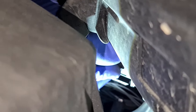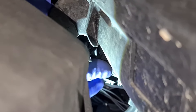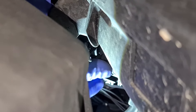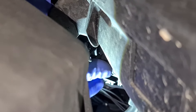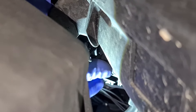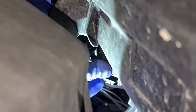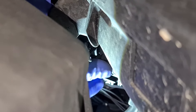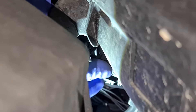Once you take it out, just remember how you put it back in. The H7 bulb pin locator should be facing up — the opposite direction of the clip, as you can see here. On the inside you can see where the sliders are and where you need to slide them through, so you've got a gap here and a gap on the other side. Now I'm going to change the bulb — just remember how I take it out, it's a bit tight. That's out. This bit here needs to be the opposite. It is an H7 bulb — you can find it in the description if you want to buy one, and we do LED ones as well.